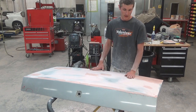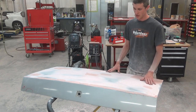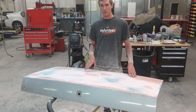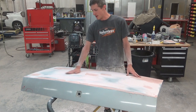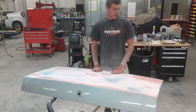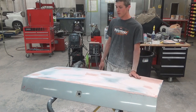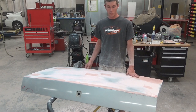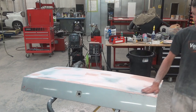We'll get everything looking good and give it the wax and grease remover treatment. I'd like to be done with the top in the next half hour, then switch over and get the front done. The panel is ready to go in the booth. The front actually did okay near as I can tell. I'm running out of time so I'm going to get some epoxy on this — I've got epoxy on the table over there mixed up. I'm going to put this thing in the booth after I wipe it down with wax and grease cleaner, let it bake, let all the solvents get out of it.